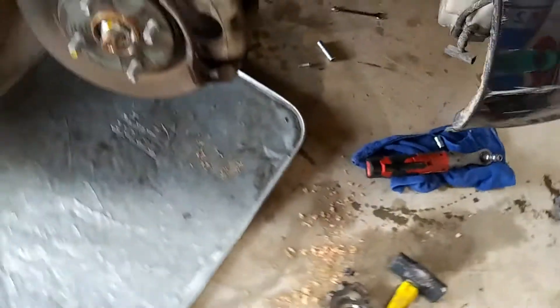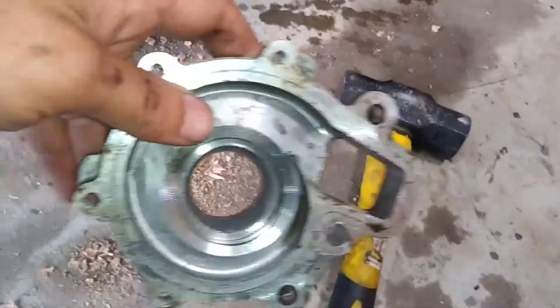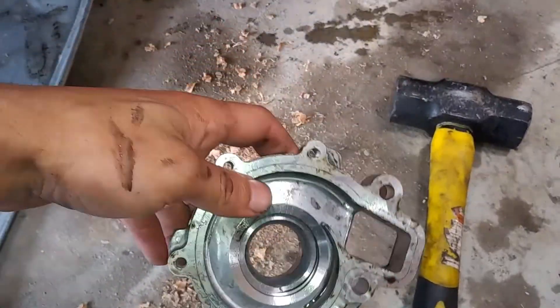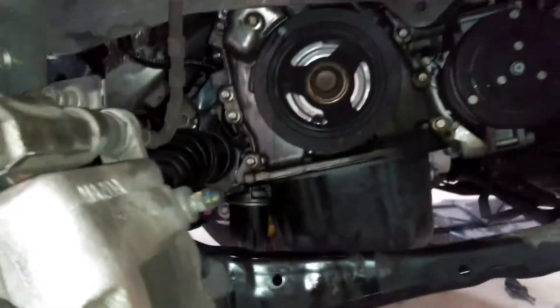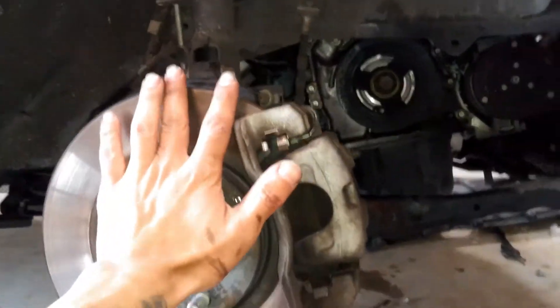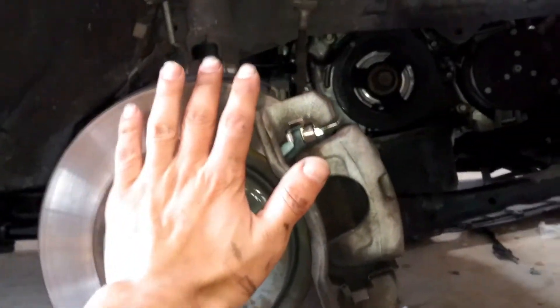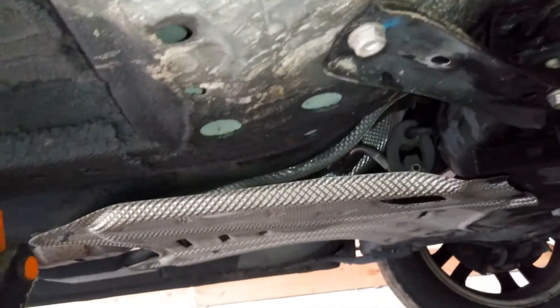This is how it's going to sit. I took off all the 8 millimeter bolts and accessed it from the passenger side — took off the passenger wheel, which is a 21 millimeter. I have the car jacked up from the subframe, the big hard piece with the notch, and I have my jack stand right there. You don't want the car to fall on you.